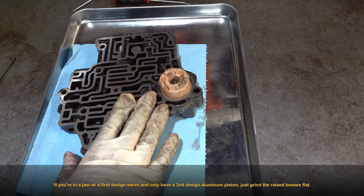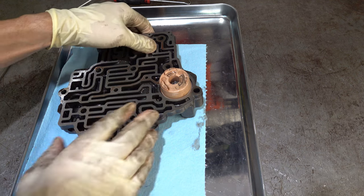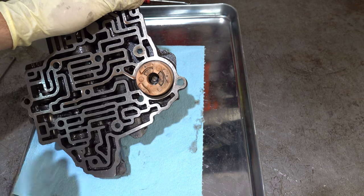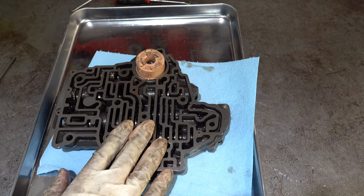When you go to purchase your aluminum piston, you want to make sure it looks just like this, if that's what your original piston looks like. The main problem with these when you go back with them is right there at the location where the e-clip is — that's where they'll crack. And it's just not worth the time. Anyway, let me go ahead and get set up here and we'll begin.